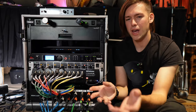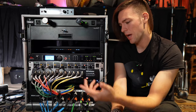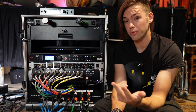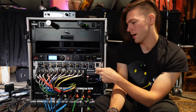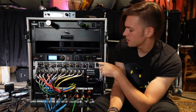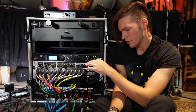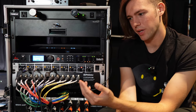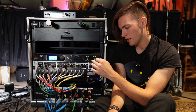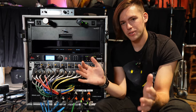The core components I have in this rack start with the PreSonus rack mixer. This is a 32-channel rack mixer with 32 inputs and around 16 outputs for monitor mixes — you can do mono mixes for wedges or in-ears, or stereo mixes for in-ears. Then there's the digital processor, the DBX DriveRack PA2. It takes two inputs — a left and right out of your mixer — and splits them into three pairs of outputs. Typically people use that for lows, mids, and highs. I'm only using two: lows and highs, splitting the signal to my sub and to my mid-highs.